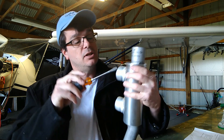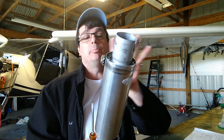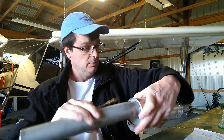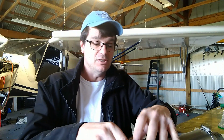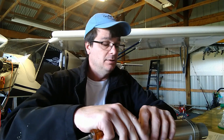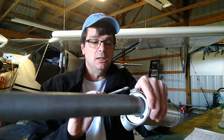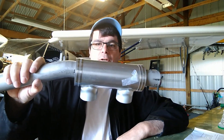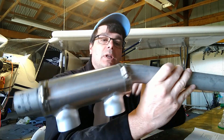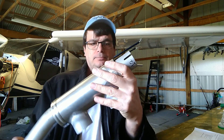I thought the end cap would capture it and you'd use the through-bolts or threaded rod to tighten up against the shroud, but that's not the case. Reading is fundamental, and sometimes I have to read — what a bother. I'm tightening up this last piece here and I officially have a Vetterman heat muff. One thing they do say is don't tighten up your end nuts until you know the orientation you need, because you can slide it around to get your hoses where you need them.